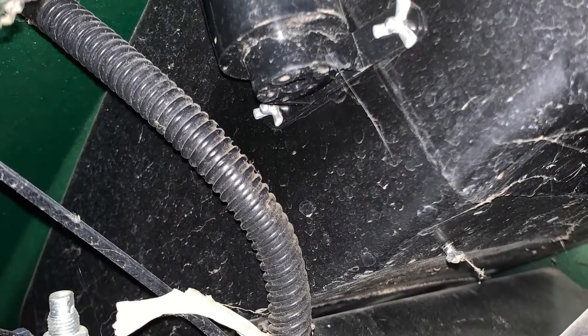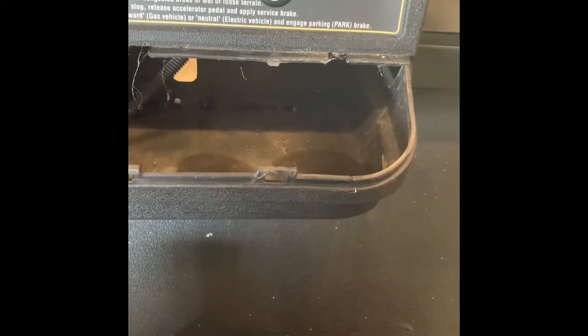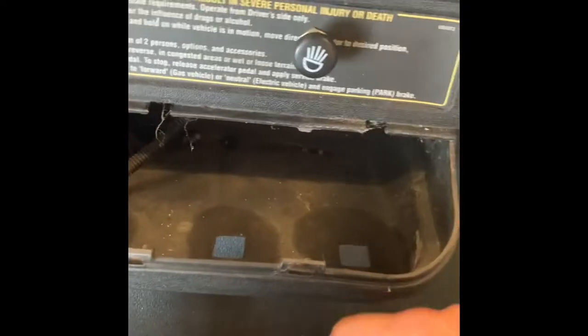Right there. And then you just take out one wire. Since it was a little dark, I took that photo so you can see exactly what it looks like back there. You can pull out either the red or the green wire, whatever you want to pull out, and that will disable the buzzer. When you go to put it in reverse, it won't be there anymore.